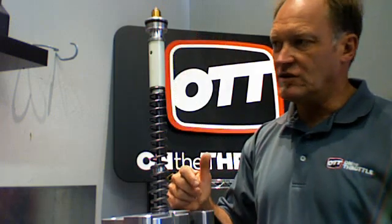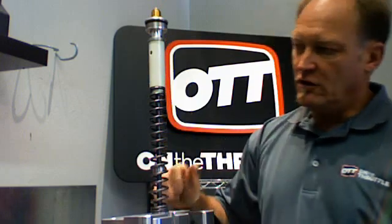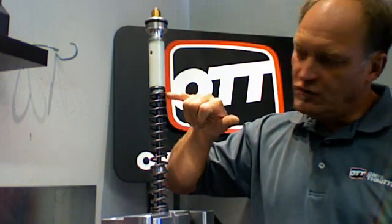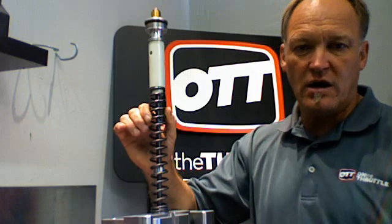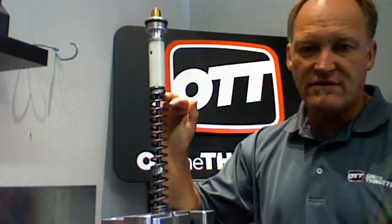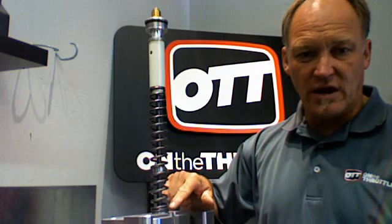When it's all put together, the preload spacer serves to add preload to the spring and hold it in place. You may also notice that underneath the first two coils of the spring, the plastic spacer has a recessed piece — almost like a dowel pin — to secure the spring so it doesn't slide around on top of a washer. Most modern preload spacers now have this dowel pin setup, which is great. That doesn't happen on the cartridge; the spring simply sits on top of the cartridge right here, so it is liable to float.